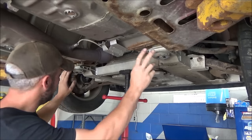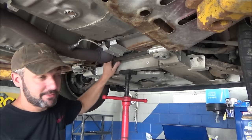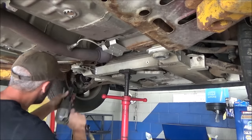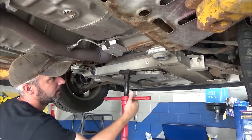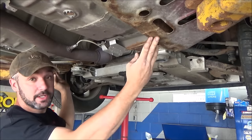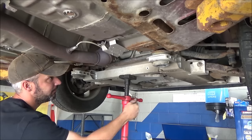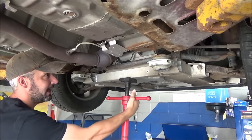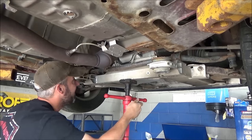I'm just going to support the rear half of the frame here and buzz the two subframe bolts out, hopefully letting it down enough to get to the brackets. If you're doing it at home and you had your jack stands under here or on the pinch welds, you could just do this part with the floor jack. You're going down quite a ways — enough to get up in there and get the sway bar loose, and you've got to have yourself enough room to get it out the back. At least that's how I take them out; there might be a better way.